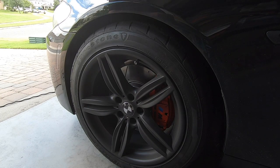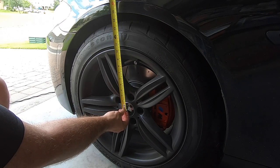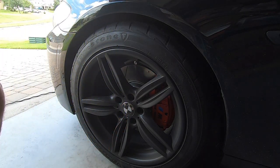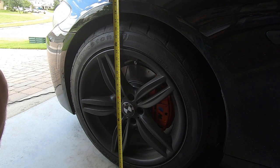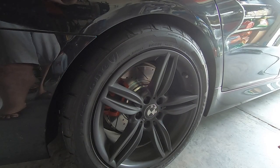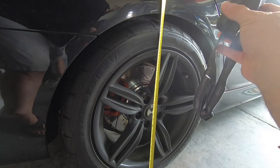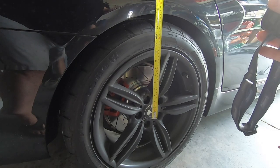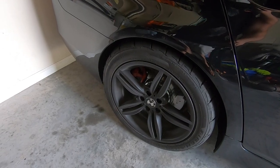I want you to take two measurements: one from the center of the wheel cap up — I'm measuring in millimeters for accuracy — which is right at 379mm, and from the ground straight up it's 710mm. In the rear, the rest are 710 but one is sitting about 712 and 375mm from the center, so just a little higher on that one. No big deal — we've got adjustable springs now.